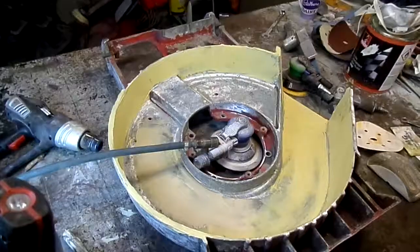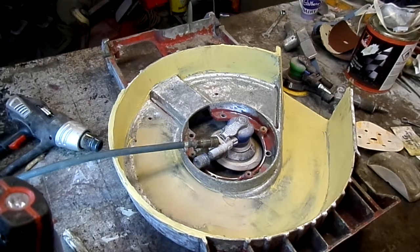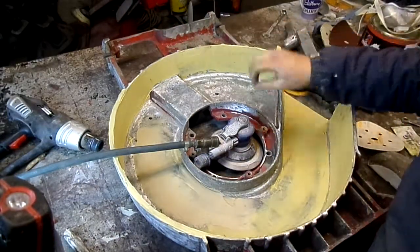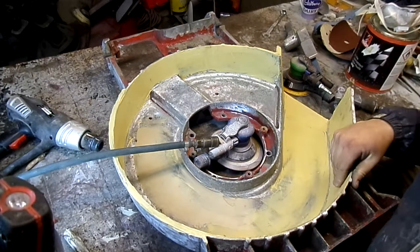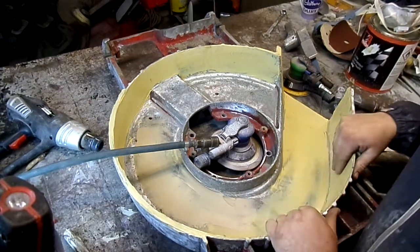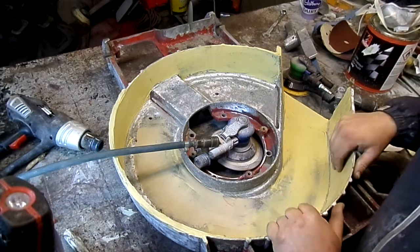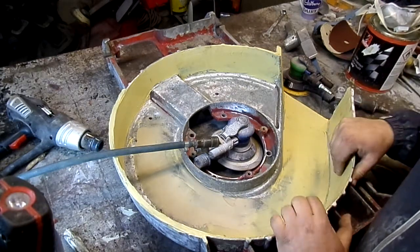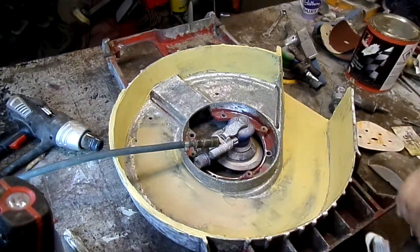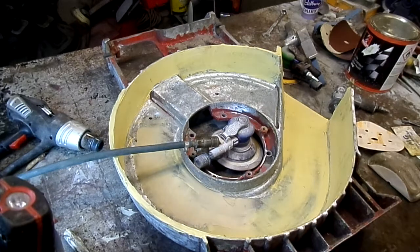Back now. Yeah, so I dried it all out for 15 minutes off camera, so it's a lot better. That's the only problem with the bodywork in the winter. Everything gets damp, you've got to dry it all back up first, which takes a bit of time before you can carry on with the next procedures. I'll use a DA on it now just to rip it down and we'll go from there.